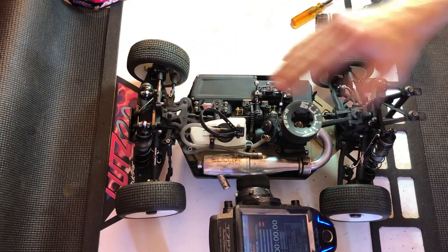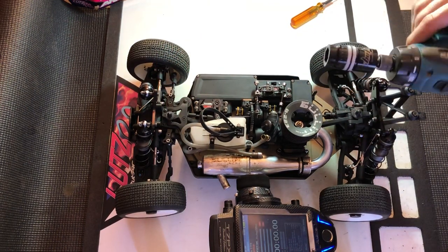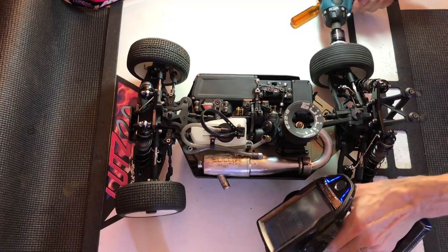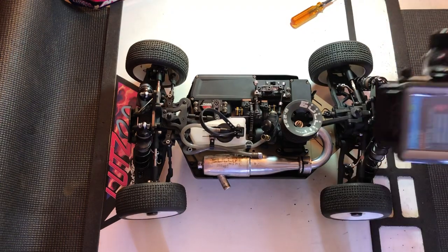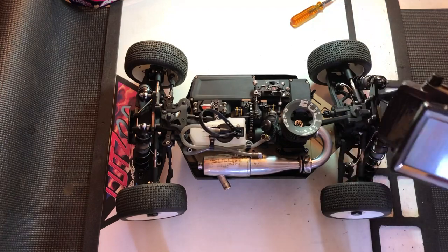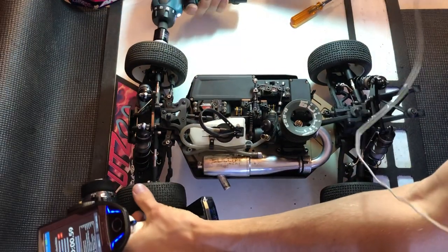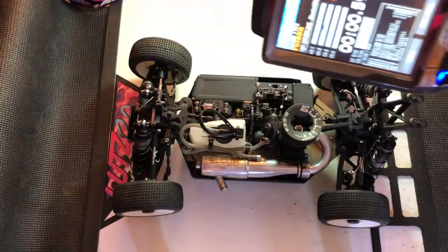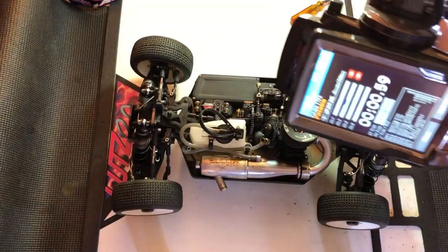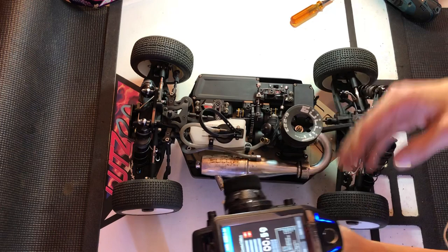So that allows me to get the bias — I feel like I have about 55-45 somewhere in there. Now if you actually have a Buku brake bias tool, you can get a measurement on that. So let's do it a couple times: rear, we got a 12 and another 12. Then the front — about 13, and 13. So right there you can see we have a little bit more front than rear bias.